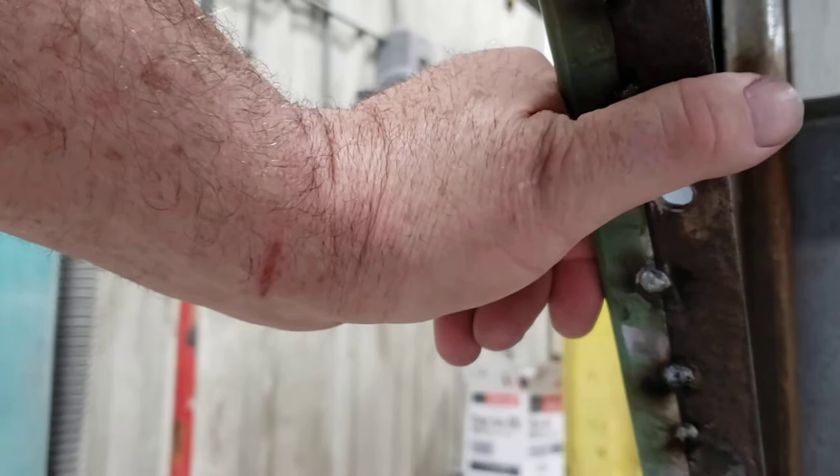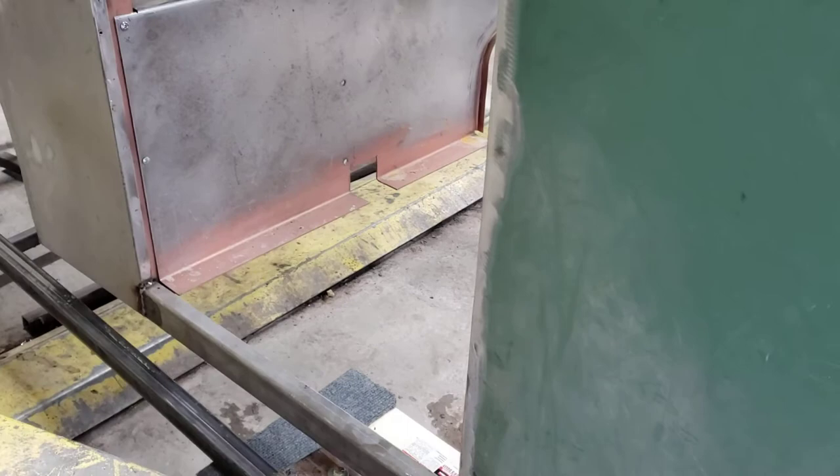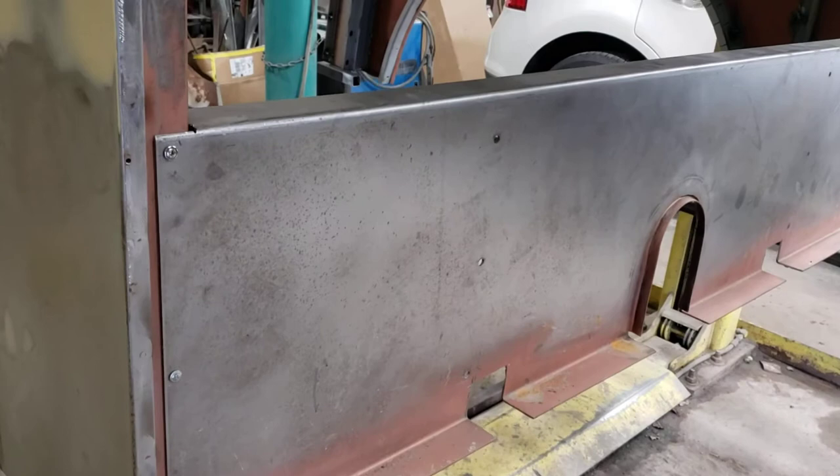I'll put the lift up to show the side panels here — these are all welded in place. We actually glued the inside area in here and glued the outer panel to this piece, then tacked it. We have to grind all of these down and get a nice wipe of two-part epoxy seam sealer. This body panel is really just bolted in right now — we may weld it, we haven't figured that out yet.